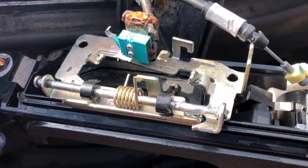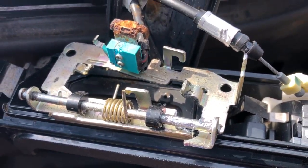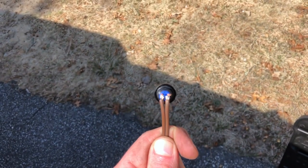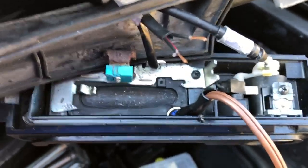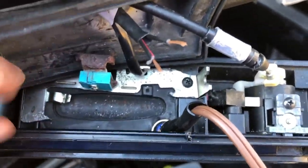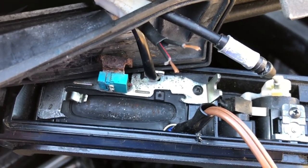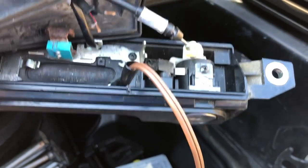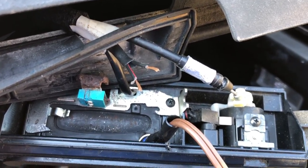We'd love to remove this whole metal assembly since it's just taking up space, but it has the retaining clip for the cable so it's probably important to put it back. I've taken this switch with my 18-gauge lamp cord and secured the wire to the terminals. I've made some pretty substantial modifications — cut away a lot of that metal bracket and screwed it back on, then cut the wire off the micro switch, stripped those connectors and wires, and secured them into the new switch. I've got a pigtail of wire running off it now, so I'll go ahead and connect those two sets of wires together.